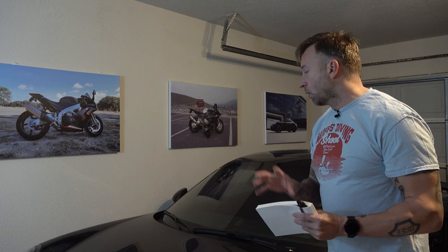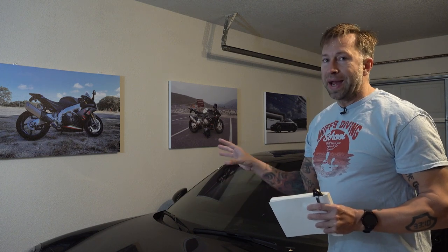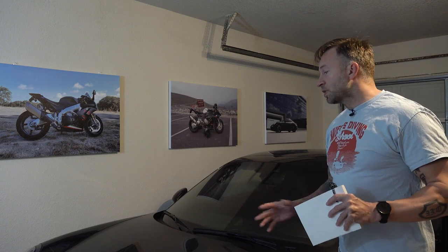Yes, you can buy batteries online for cheaper than the dealership. I'm in a bit of a hurry because I'm supposed to drive to Phoenix Thursday morning, so I needed something quick and wanted a place to return the core without getting stuck with a dead battery. You would think all batteries for a 2014 would be the same, but when I called the dealer they actually had two or three different amp hour ratings. I had to give them my VIN number so they could confirm this takes the 95 amp hour capacity battery. So if you're ordering online, don't blindly order a 2014 battery — there are variations. Make sure you get the same capacity as what you've got.